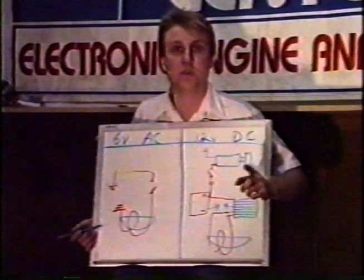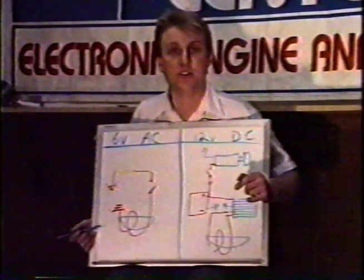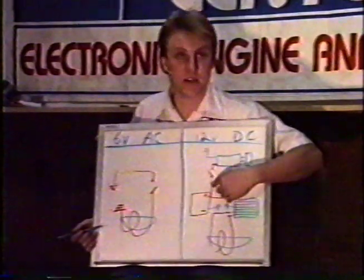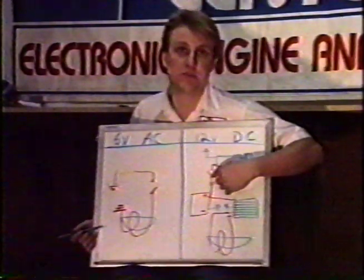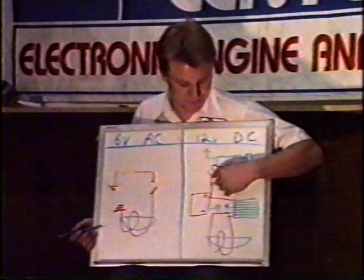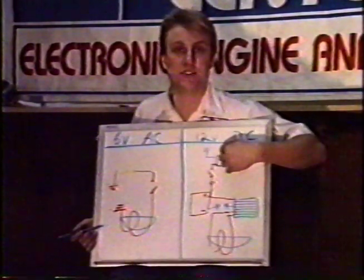There's also a brown wire on this particular regulator rectifier. You can cut that off and insulate it. You don't need it for this application. From your battery, run about a 15 amp fuse just before your switch, which you can again use a mercury switch, modified turn signal switch, any type of switch you prefer, from the switch to the gyro motor, from the gyro motor directly to ground.